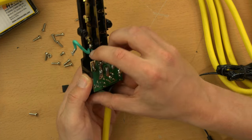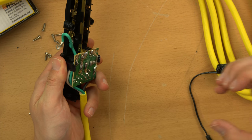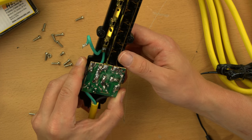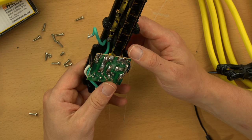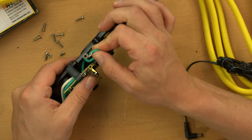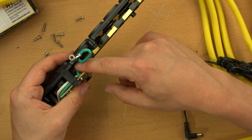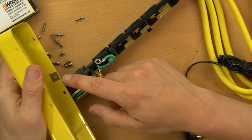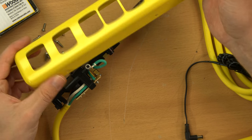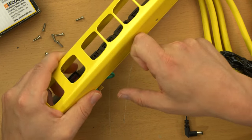The other reason it's not easy to take this board off is that the switch pushes in from the front, clicks into place, and has a face plate preventing it from pulling out. So they presumably put the switch in first, then soldered the board onto the switch. I would have to desolder those heavy pads to remove it. It does have a jumper coming off the grounding wire from the cord set, screwed onto the side of the case where the paint is masked off for metal-on-metal contact - so it is at least properly bonded to ground. But they might as well have made this out of plastic since the back already is plastic.